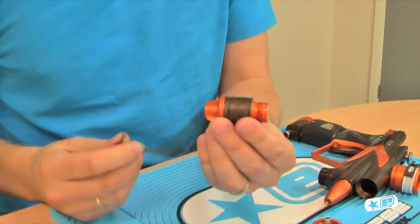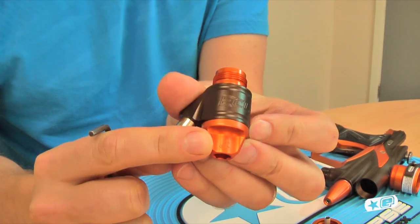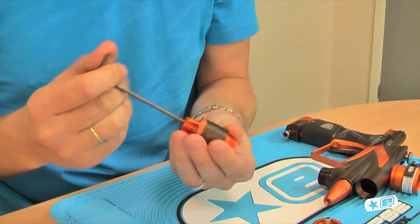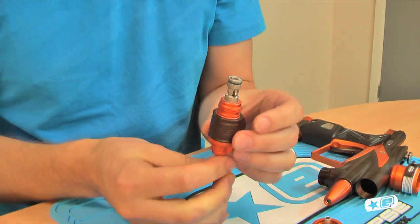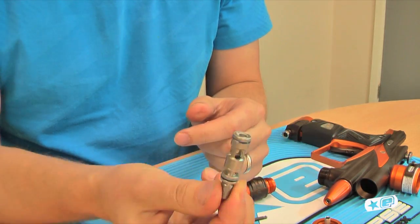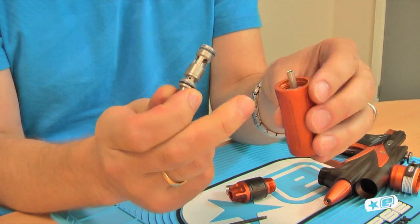In the bottom half we've got the 1/8 adjuster — obviously as we've been doing for the last couple of years now, you've got a plus and minus actually on the reg bottom to tell you which way to turn it and set it. Screw the adjuster all the way out and it pops out to the top. The adjuster is now a much bigger unit. The reg seat is actually built into the adjuster now — it's not part of the end of the piston. That's just a tube now; the piston's just tubular.